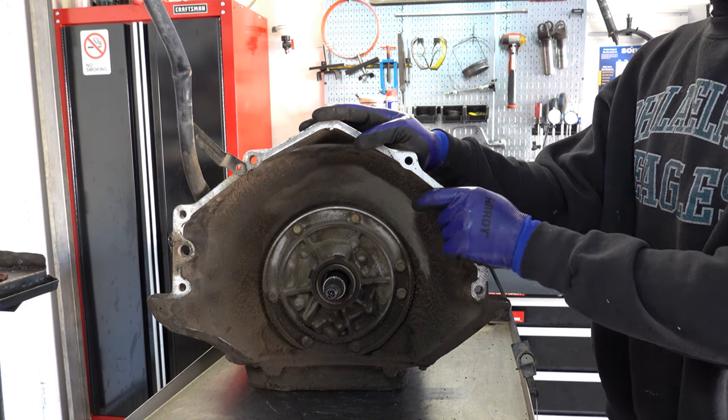One thing you notice right away is you have a bathtub here on earlier units. Let me see if I can get that to show a little bit better. So on earlier units, there was a check ball here, and in the spacer plate, you'll notice right here, there was another round hole right next to this one. And when you see that, if you see two round holes, then especially if there's a bathtub underneath, that would imply that a check ball goes there. Almost invariably, that's going to hold true. In this case, because we have a square hole, there's no check ball there. And then you see the rest of the check ball locations.